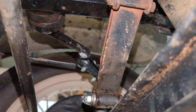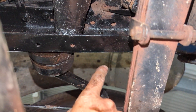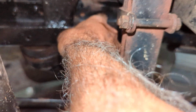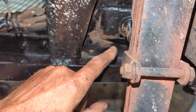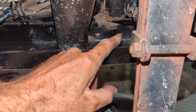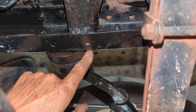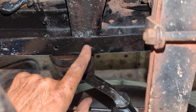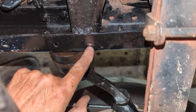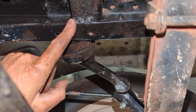I've seen on other videos that the cross member is supposed to be riveted in, and it's got two holes here. That hole there lines up with a hole in the chassis — it hasn't got a rivet in it obviously, that one doesn't. There are also holes on either side underneath the cross member that don't line up with any holes in the cross member. It appears to me that the cross member is sitting back maybe half an inch too far.